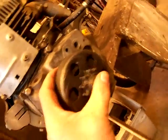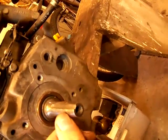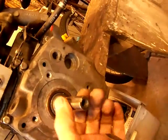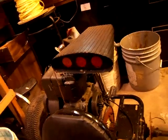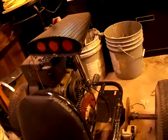This particular clutch doesn't have Allen screws or set screws — it just floats on there. So I'll need to cut it off where it needs to be and put in a retaining bolt on this side. Then I'll be good to go to put it on the go-kart, which currently has a five horse that I just modified to a ten horse, so it will be significantly more powerful. I'll have to modify my intake to fit the new engine, but it should be lots of fun for my son and I.